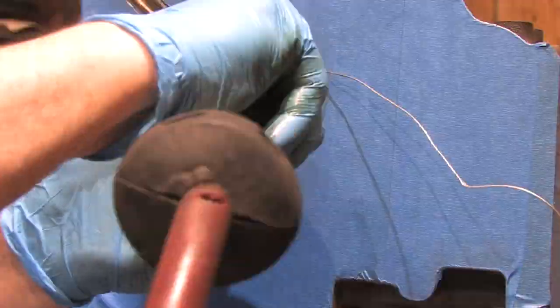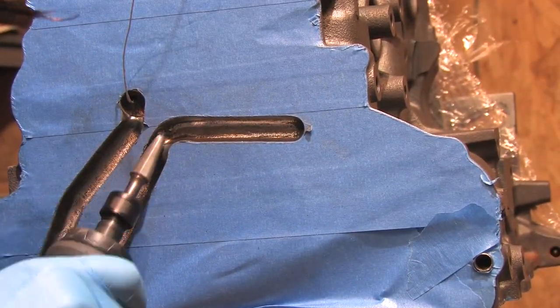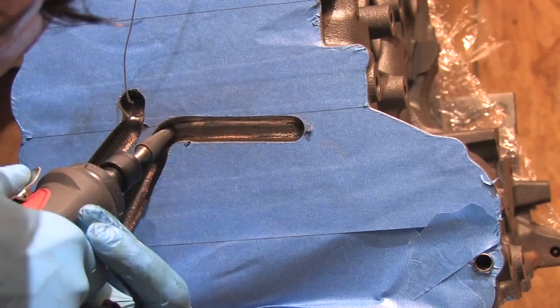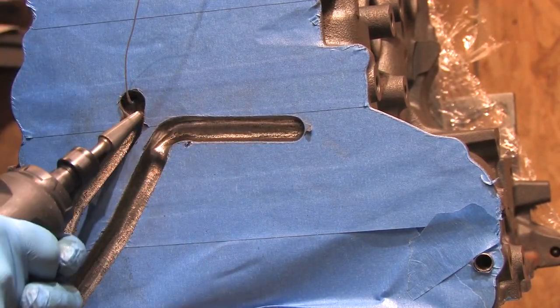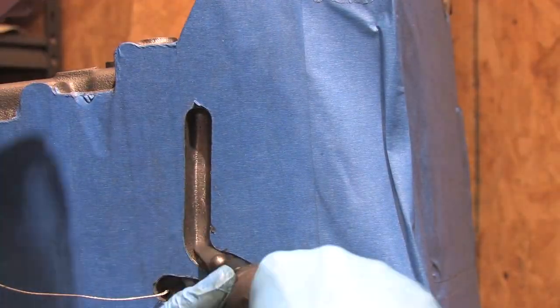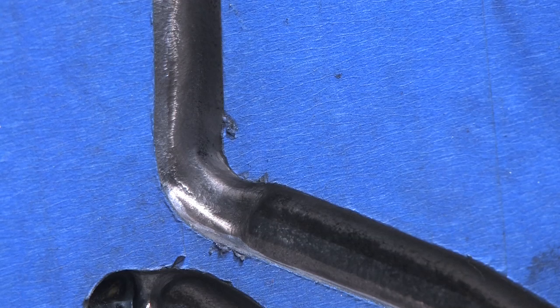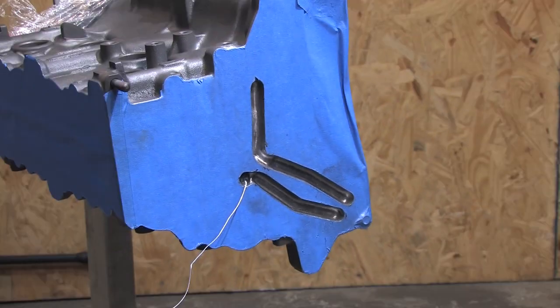You want this to be delicate, but remember that this is the rough cut. Don't spend all day with this — you also want to be deliberate. Give your compressor a break once in a while, especially if it's smaller than a 30-gallon, because your air supply won't keep up with the tool and you'll burn out your compressor. Mine's a 45-gallon so I have no problem there, but I still let it charge all the way up and cool off every 10 or 15 minutes.